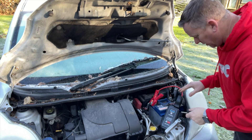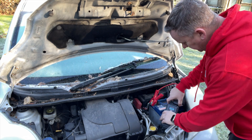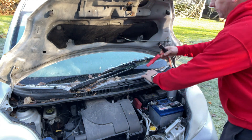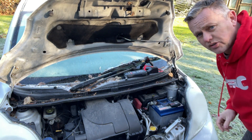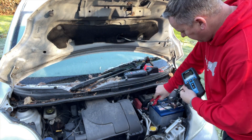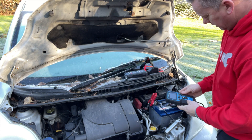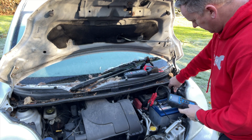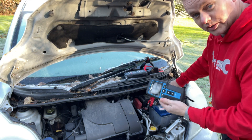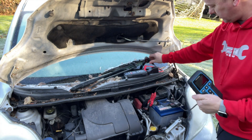I'm sure the battery won't have come back to life. I'm going to get the battery tester and put it on the battery just to see what state it's at. This battery is a 440 amp EN battery. Let's get a decent connection on there. It's that dead - that's how bad it is - the battery is so flat I can't even get a reading off it at all. It's totally flat, totally stone dead.